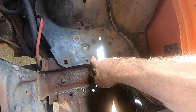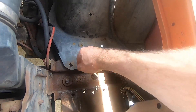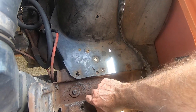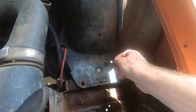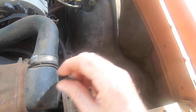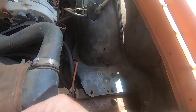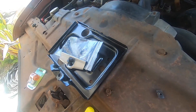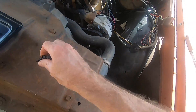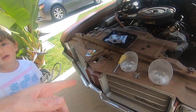I spent a lot of time digging out the older bolts with these, which are called pierce nuts. I've actually gotten the ability to thread in some of the new fasteners for the battery tray, which is good. But I had a challenge trying to get this other pierce nut cleared out with the old fastener, so I'm going to have to get another one of those. At least we got the tray somewhat able to get mounted with at least a couple of bolts — so that's some progress. Let's get the lenses back together.